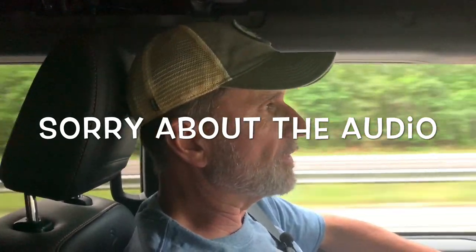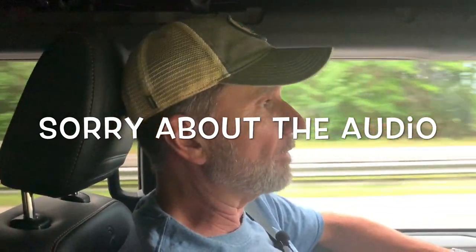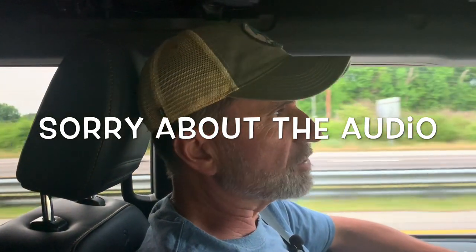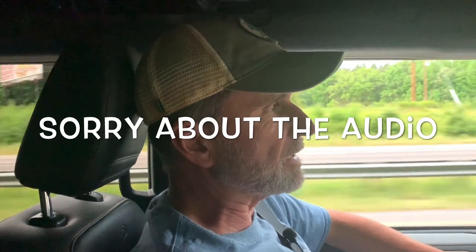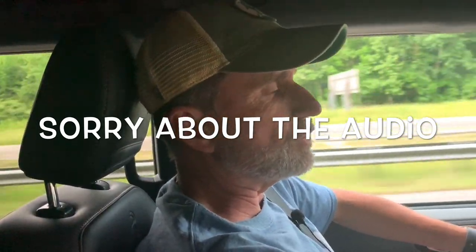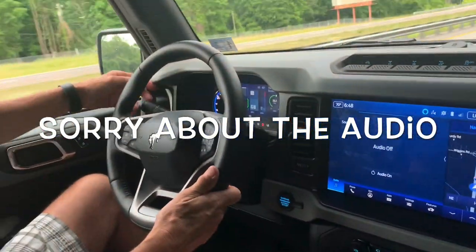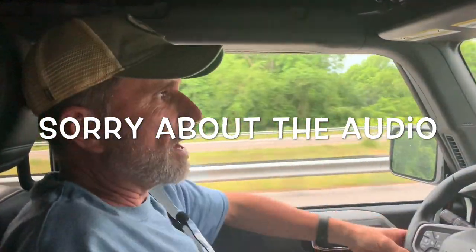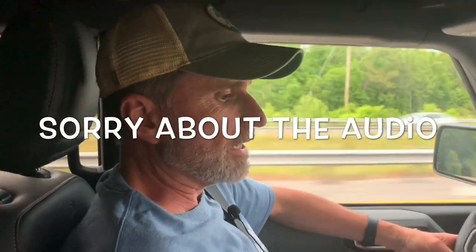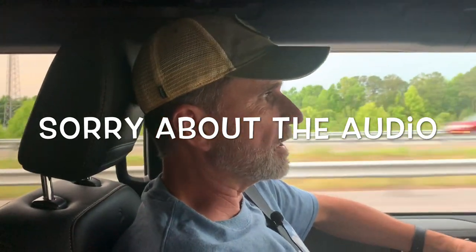Okay, so we were going to shoot the late afternoon sun here when it was going to be at the hottest point, maybe about 95 today, but it only made it to 88 driving. When we did the video earlier, you saw that we were in the mid-sixties in the back seat — 66 to be exact, 69 in the front, and the fan was on fan speed four. So you can tell if you use your two dash vents and angle them so that they're blowing between the front seats, and if you use the side vents and blow them between the door panel and the side of the driver seat and the passenger seat, it cools just fine in the back. If you turn the fan on high, the temperature to low in the conditions we had today — 88-ish degrees — it cools it down pretty well.